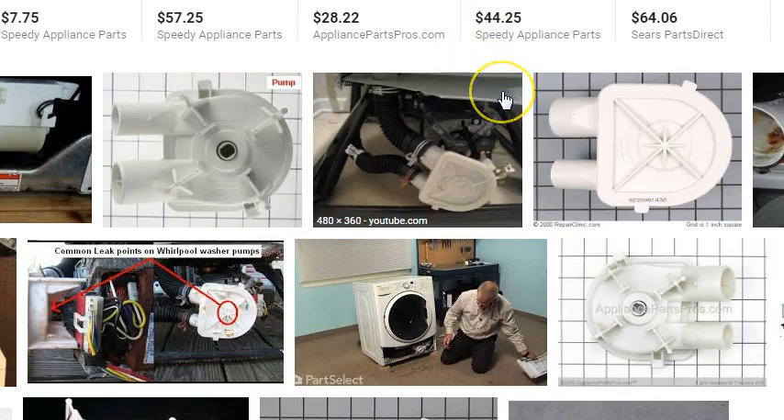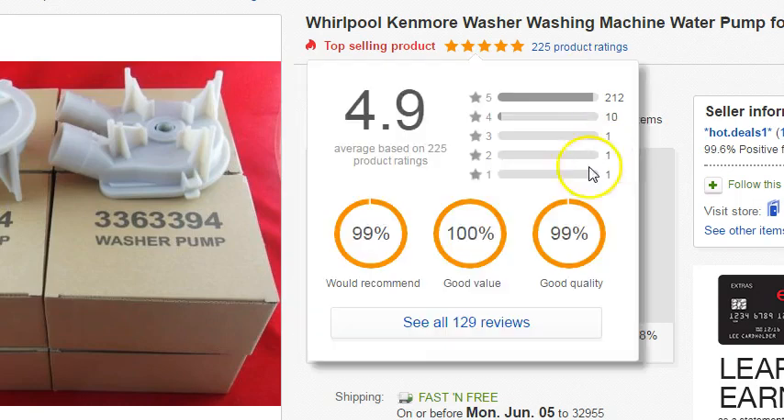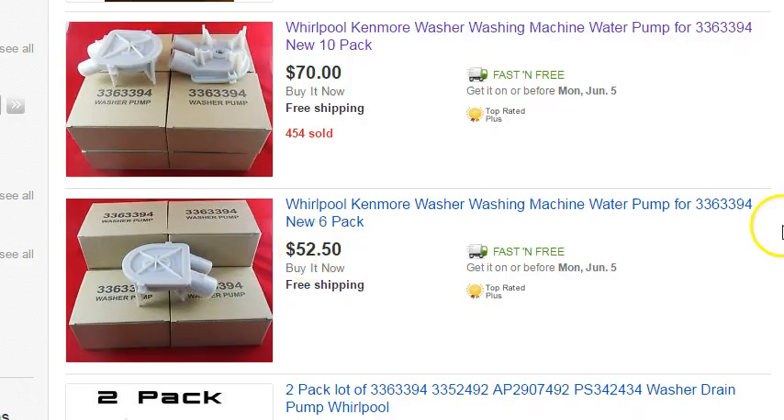It's because people fill the load of laundry, turn around and see one article of clothing on the floor, so they toss it in and shut the lid. It floats its way over to the top edge between the inner and outer tub, and the sock comes down to the drain. Most of the time they go around the pump and out the drain — that's where the disappearing sock phenomenon comes from. But in some percentage of cases the sock will come down, bind up inside the pump, stop the pump from moving, stop the motor from moving, and stop the transmission from moving. That sock will block the entire pump, and the customer calls and says their washing machine is not draining.